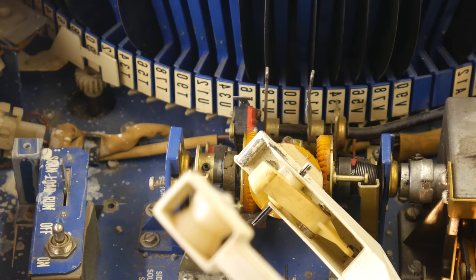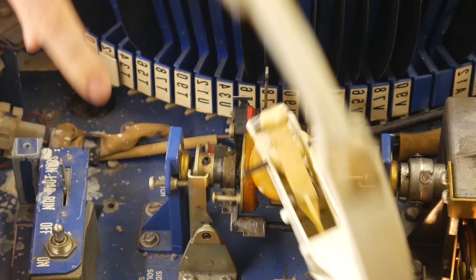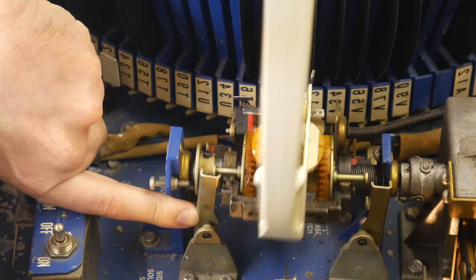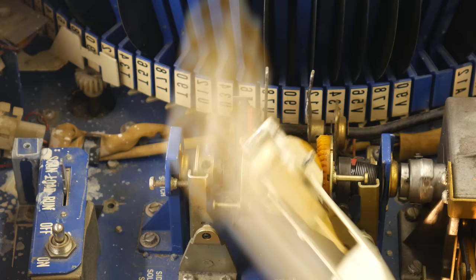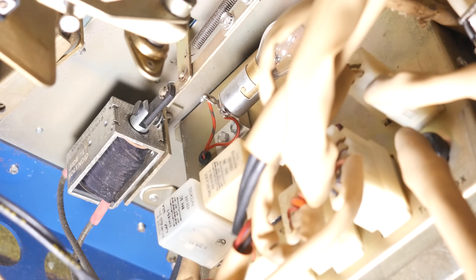We can change which pin gets stopped. So there's a little mechanism that moves left and right to change which of those pins gets caught. And if the side 1 readout is the one that's activated, the side 1 relay, in addition to stopping the carousel motor and all that stuff, will send power to a solenoid that moves that bracket over. So essentially, if we have selected side 1, then that relay energizes, which pulls in that solenoid, and that changes which direction the record changer arm will land, or which direction the record changer arm will pivot before it lands